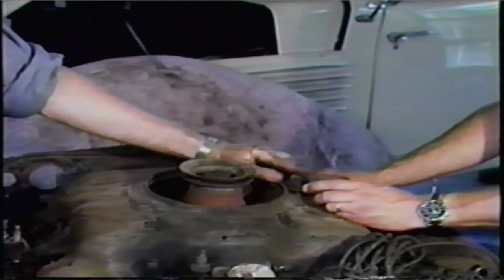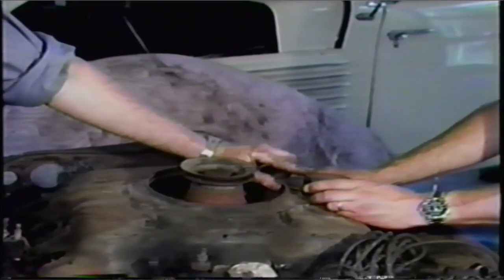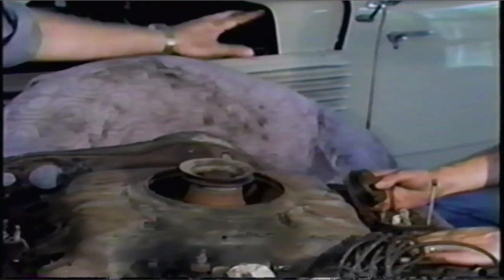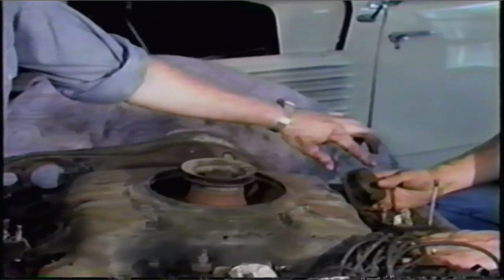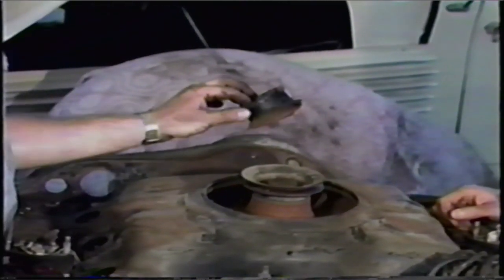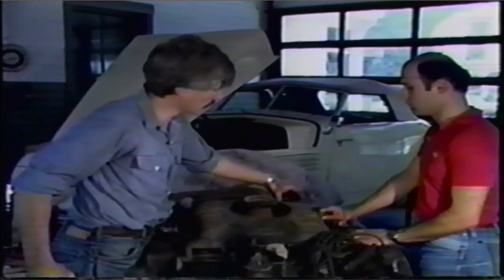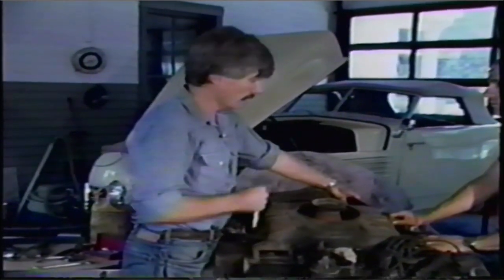So this is a cool air hose. If this hose is broken, it'll cause your engine to run hotter because a good volume of the air going through the engine is diverted out this hose and never forced through the engine to cool it. If you want your engine to run cooler, I recommend just blocking this off entirely, because very seldom do you need to make the hot air in your car cooler. I try to convince my customers to let me put a small piece of aluminum across here as a baffle — put the thing back together and it makes the heat actually warmer in your car and makes your engine run cooler.